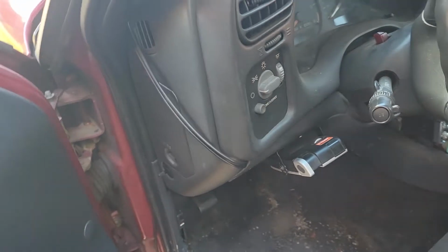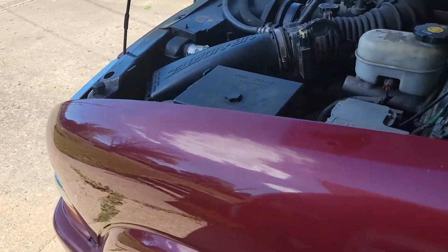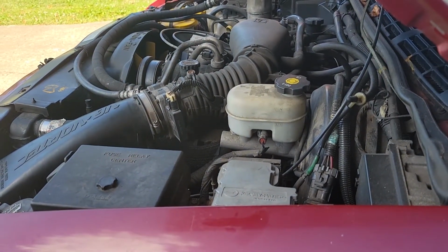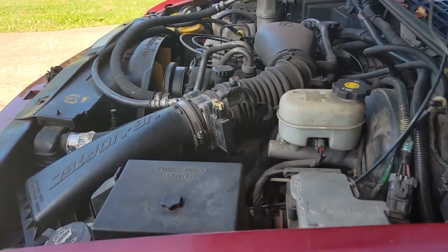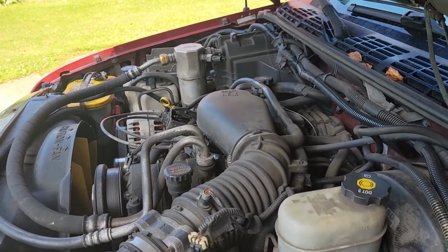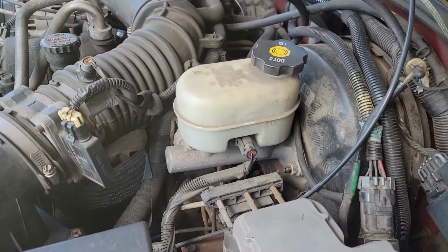And you just run those wires back with the other wires you had to run back for your 7-way. The additional wires for the 7-way I ran, so it was the brakes. I ran that wire for the brake actuator, well, the brake trigger. And I think the only other one I ran was a wire for 12 volt. Everything else was back there. So it's pretty simple